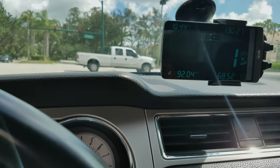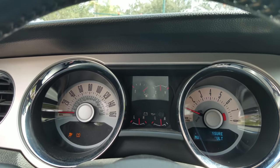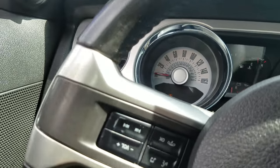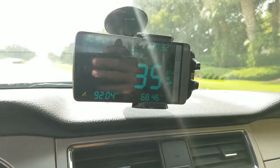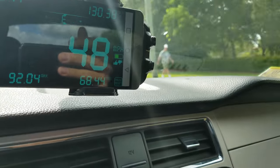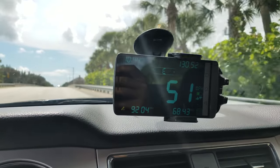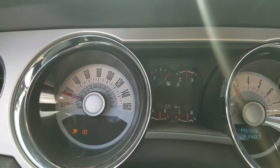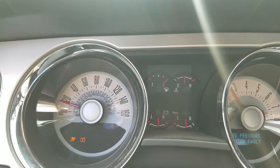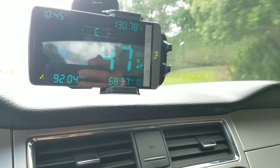It's the next day — we wired in the output shaft speed sensor. I'm going to show you why I'm getting 4.30s coupled with the T56 — look at the miles per hour. The output shaft signal is wrong — I'm actually going 35 and it shows 19. That's because the stock transmission has 32 holes in the output shaft speed sensor. The T56 has a different number, so I'm going to tune it using HP Tuners and change it in the tune.